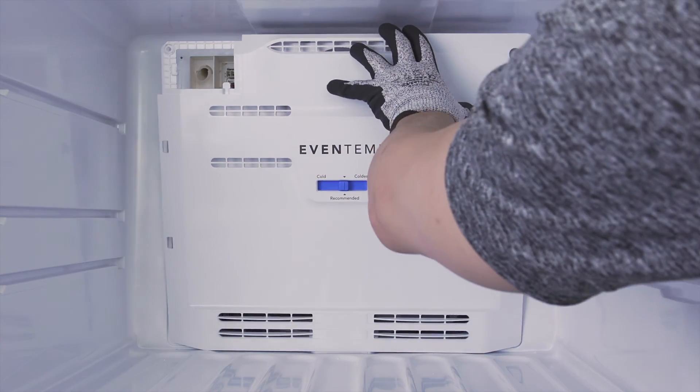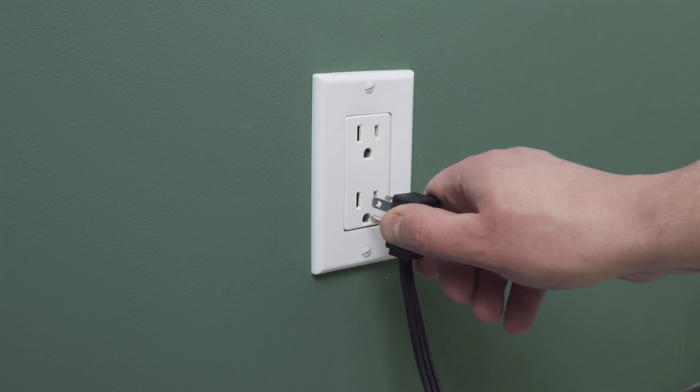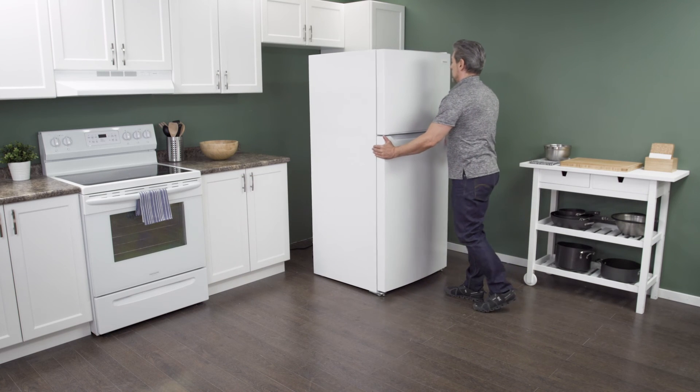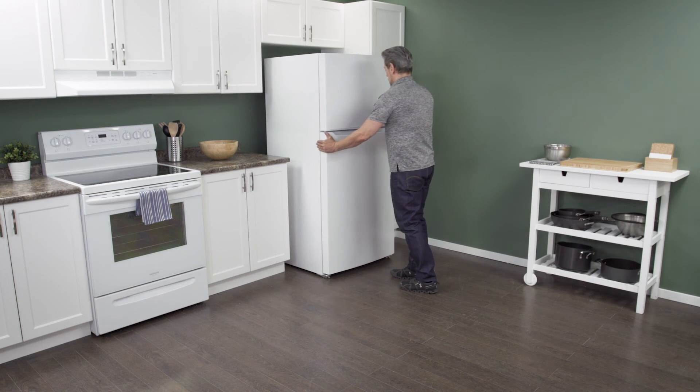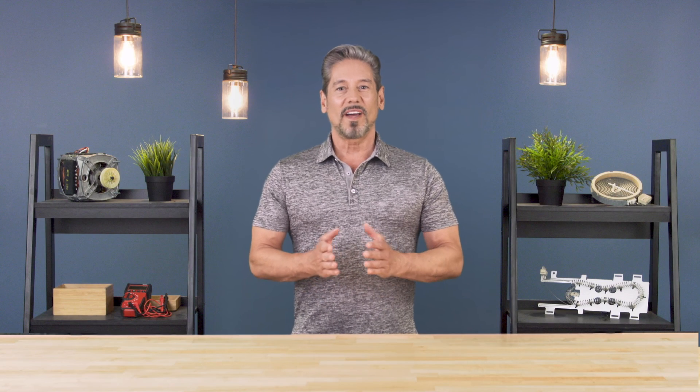If needed, align the freezer panel and tighten the screws. Plug in the cord to reconnect the power, then slide it back into place. Make sure to leave a couple of inches of space between the refrigerator and the wall to allow for proper air flow. Now test the refrigerator to see if it's working properly. If you like this and want to see more tutorials and informational videos, subscribe to our channel. And if you need help, you can call or visit an AMRE location to talk with our knowledgeable staff. Thanks for watching.